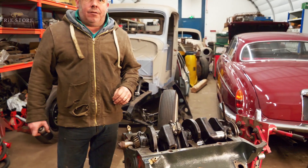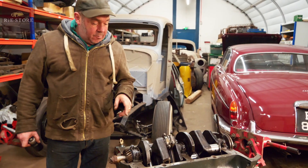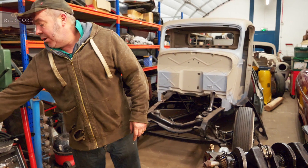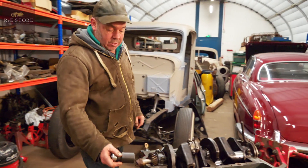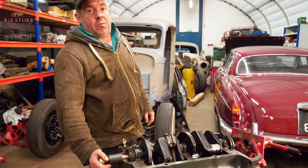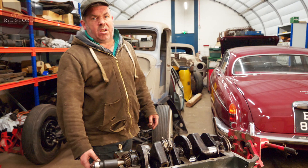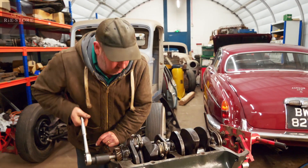The parts of it seem really smooth and other parts a bit more. I mean, you've got different thrust faces on your piston. You've got to remember you've got all of those piston rings — they're all forcing against the bores. And you've only got four pistons in there at the moment. That Buick engine when I built it, you couldn't turn it over by hand — but that's not tight for an engine at all. That's fine.